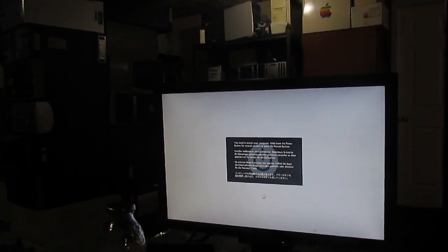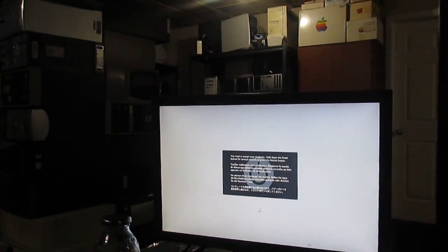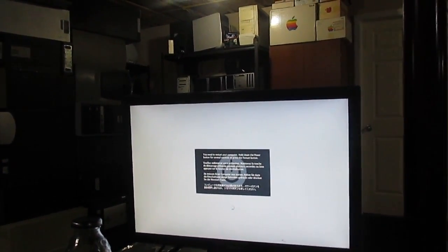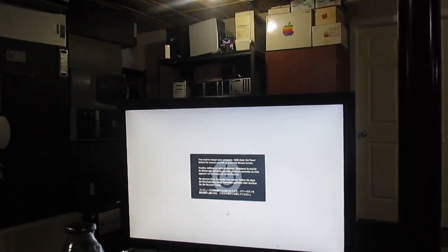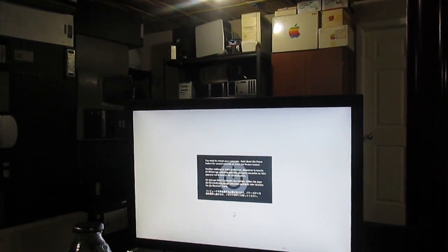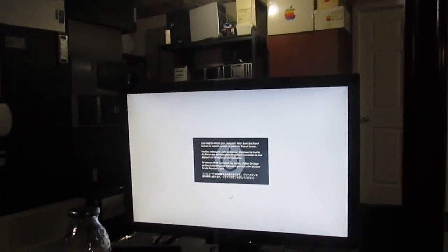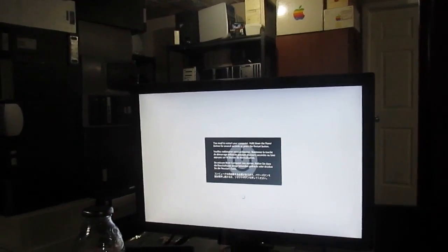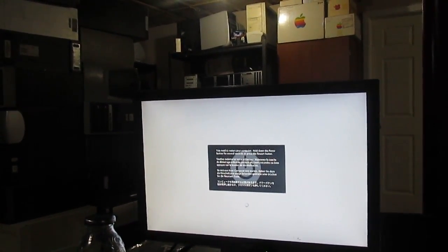Alright, so it's a while later. I'm probably gonna have to reburn my OS 10.3 install disk number 2 because it's completely destroyed. It's not even that scratched up and it really just won't even read from it. That's why the installer keeps failing. I restarted after another failed attempt at trying to do the 10.3.9 combined update, and now I get this.